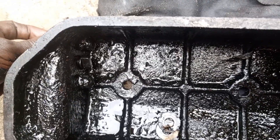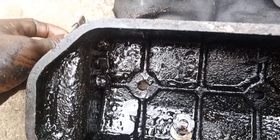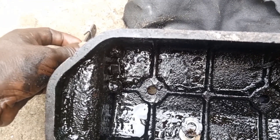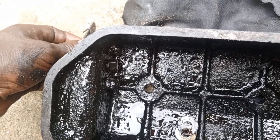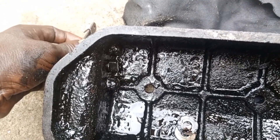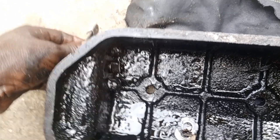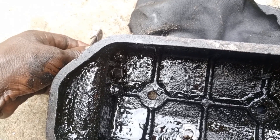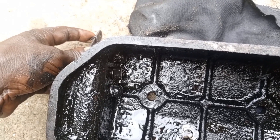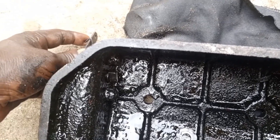So the engine can run freely. This is usually used when the engine is already starting with manual starting — you're not using a starter. The decompression lever helps you eliminate compression. When you press it down, it helps the intake valve to remain open and steady, so there will not be any compression stroke until you release it, which then allows the engine to have compression.